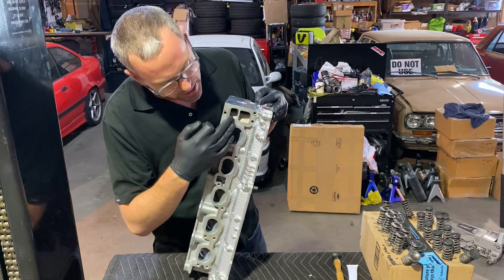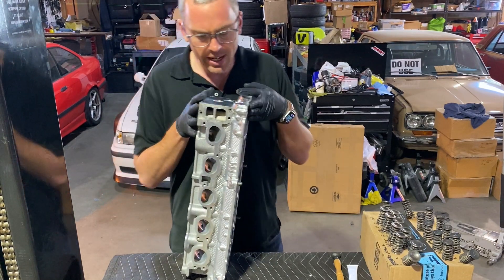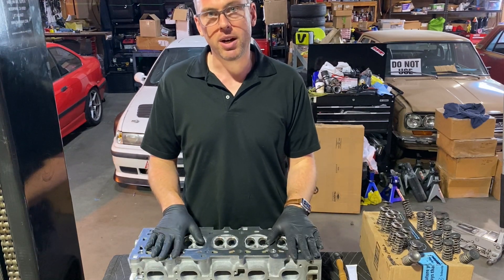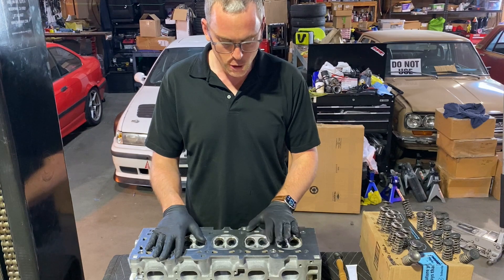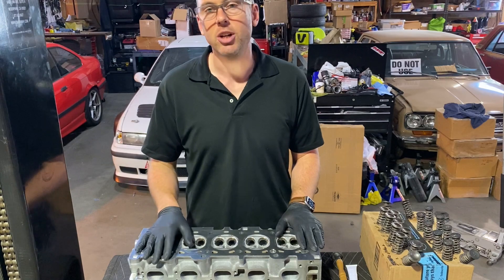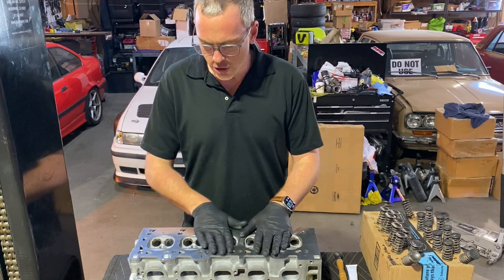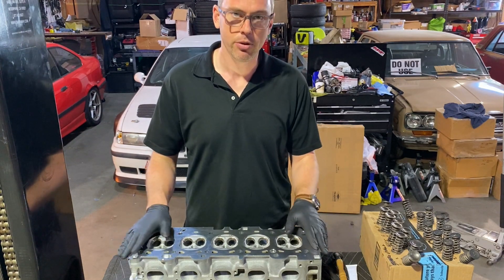Stage three, which I did not opt for, goes all the way into the full ports. I went for the recommendation of the port and polishing guy — I said I just want the best bang for the buck. He took a look at it and said your biggest bang is going to be stage two, that's going to give you over 30% more flow than you have now in certain RPM ranges. After hearing that and that it was fairly recommended on these motors, I decided to pull the trigger.